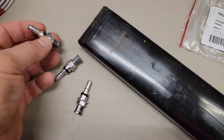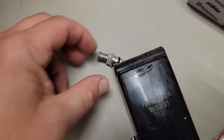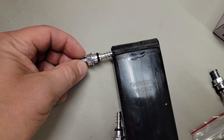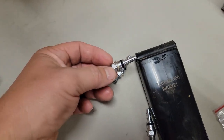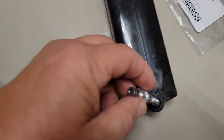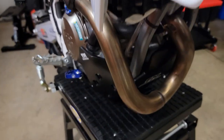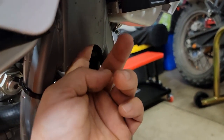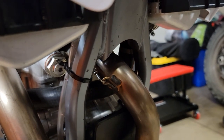What you do is this goes into the bike at the bottom part, kind of facing forward towards the motor. These little things are in each part of your frame and this is what helps hold it in there. You remove these — I think it was an 8 or 10 millimeter — and you screw this out, and this one, and this one. Then this charcoal canister literally drops out. And there's a little piece of foil that just pulls out; it's stuck on there with sticky adhesive and you can reuse that on the new one.